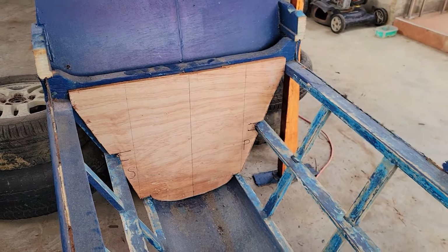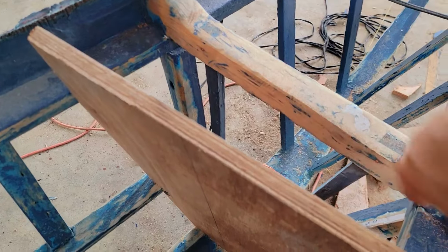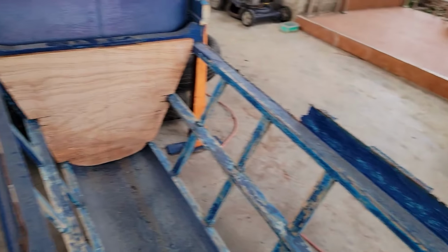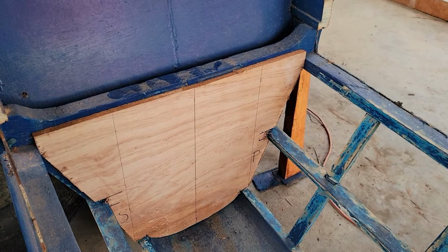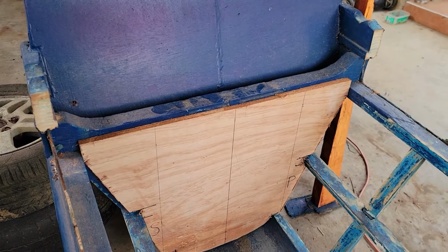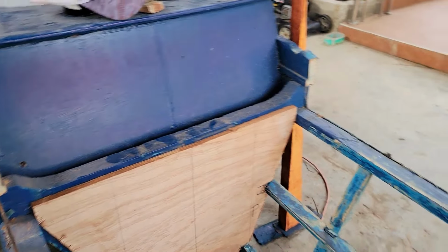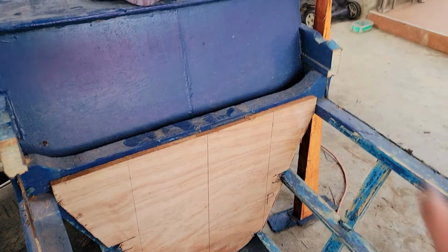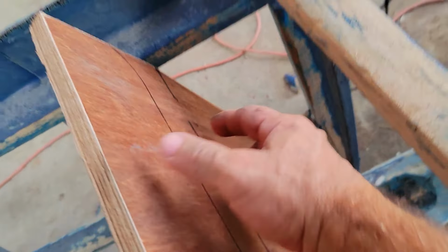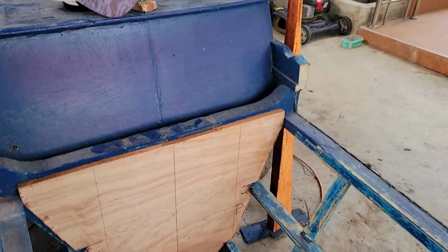It's gonna be cool. I went around on this opening here already and did a lot of sanding with that little flapper disc on the grinder. Before I put these bulkheads in, I'm gonna mix up epoxy resin and coat them all the way around, and that way they'll really be marinized. Then I will also take epoxy and go around any place that's going to make contact, and push it up on there while it's wet, after the first coat of epoxy on the wood itself dries. I've already gone around on this one and marked where those contact areas are going to be so that I know exactly where to put it. I'll do the same thing on this one. I'll go to the back side and mark where the contact areas will be.